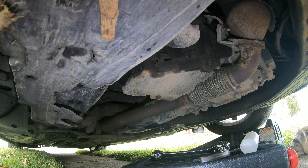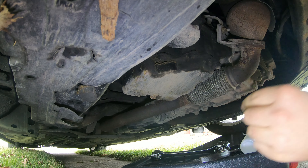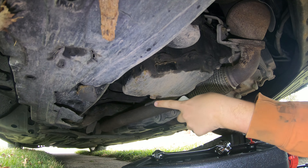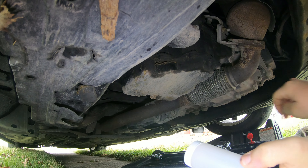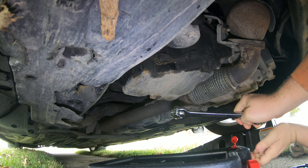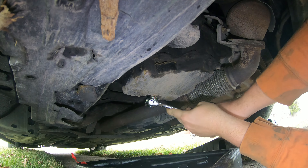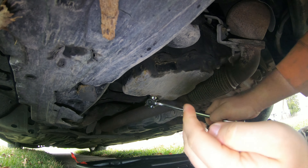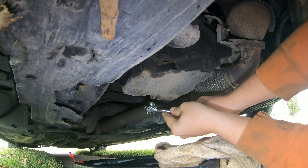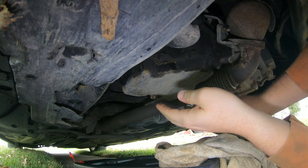I'm trying to get you guys the best view possible, which is near impossible. I've got a little magnet that I always hope collects something. I've got my oil filter right there and in the back I've got my drain plug — this is empty. I'm getting it from here instead of easily pouring it out of the filter because the filter kind of catches everything and I want to see what's in there. I'm going to catch it while it's draining out and fill it all the way up. Got a rag on hand, got my 15 millimeter on my cart.